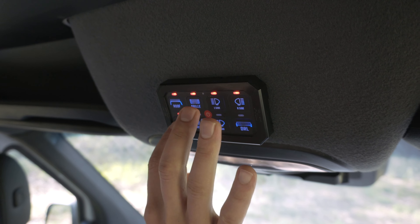Welcome to the back of this van, where we fitted it with some custom-made wooden panels to keep that wood style going from the ceiling down to the doors. We also added a lot of little knickknacks like netting storage all over the van. This opens up to our massive under-bed storage — we fitted everything to the walls as much as possible, squeezing every inch for the water system and electrical system. We have a thousand amp hours in here — super beefy electrical system with Dakota lithium batteries. It's the only way to fit that many amp hours and still have this much storage space. They can handle negative 20 degrees Fahrenheit. And we have the coolest back storage cubbies that we've ever done or really have seen.